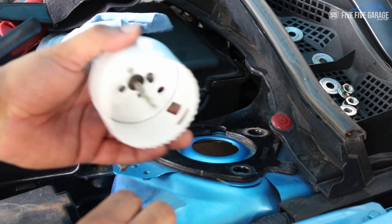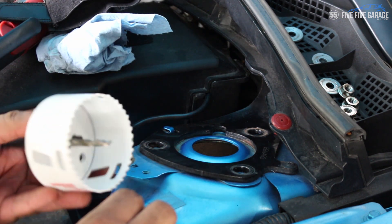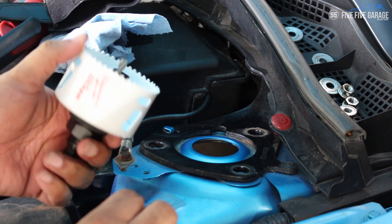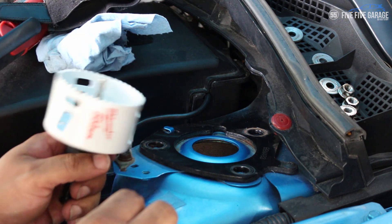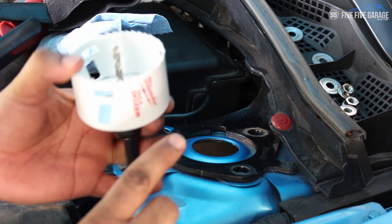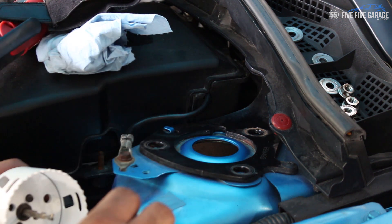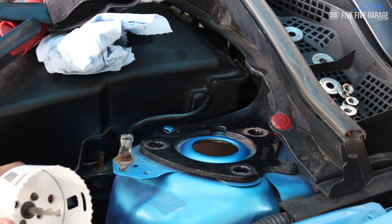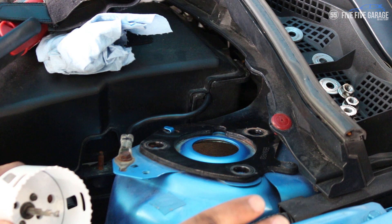I was a little apprehensive at first, but I've seen other people do it, which gave me the confidence. A few things to remember: number one, you're going to need some lubrication on the teeth to make sure it cuts all the way through without wearing them down. Number two, this is a carbide tooth hole saw — the bi-metal will not cut this, so make sure you get carbide. Number three, wear eye protection because metal shards and splinters will get everywhere. Number four, take your time, go slow, maintain a decent speed and everything should go great.